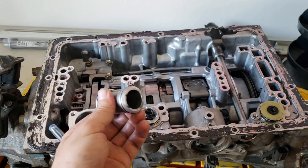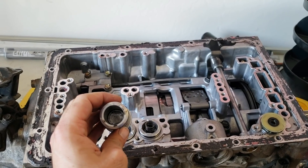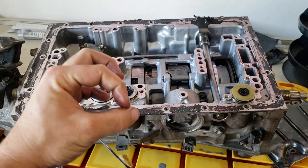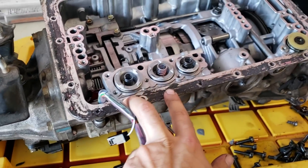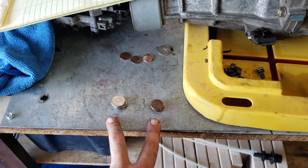One thing to note is that these accumulators are tapered — at the bottom they're only 19 millimeters and they taper all the way up to 21 millimeters. So you want to go out and buy washers according to that diameter. But the easiest way to do it is for the first two accumulators you can use five pennies and five nickels, which gives you 18 millimeters.